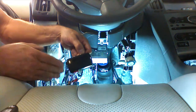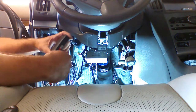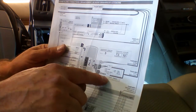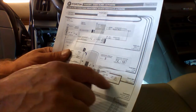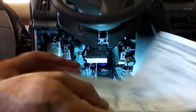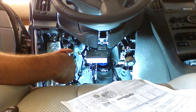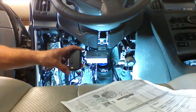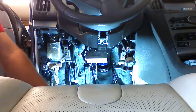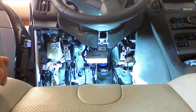With the light on solid yellow, plug in the remaining connectors — start with the 20-pin, then the CAN plug which is white on the back, then the RL plug. The vehicle can require either RL1 or RL2 — there's a list of vehicles indicating which one. For the G25, we need to plug in RL1. If you plug in RL2 and go to activate, the brake lights won't come on, meaning the brake pedal is not being held by the device and the vehicle will not crank. So it's important to select the correct RL. When we test start it, we always look at the brake lights — they should illuminate when the device is activated. This is an indication that we have the correct RL selected.